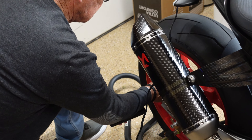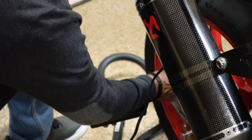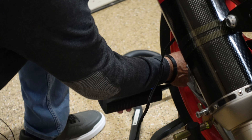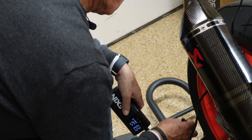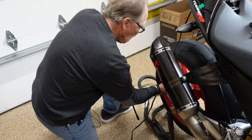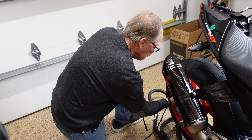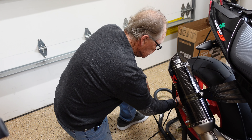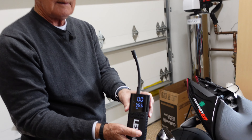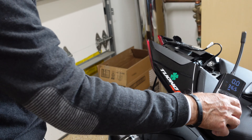You always lose maybe a quarter PSI anyway. The setting per the manual for the Tuono rear tire is 36.26 PSI — and this is my Fobo tire remote tire monitoring system. So let's push this back on. We got it on, it stopped automatically. Worked perfect.